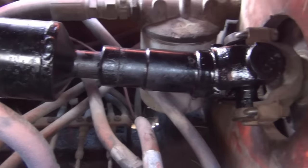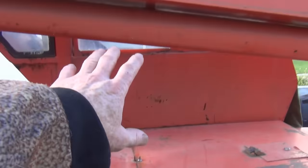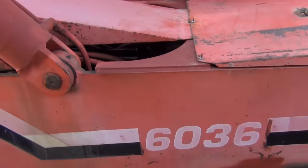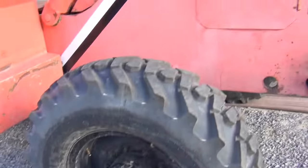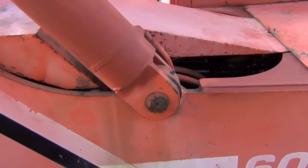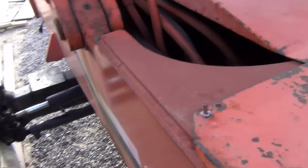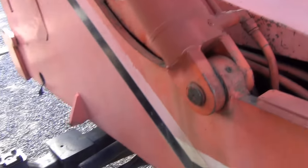That's a good repair. I spray painted it using some ceramic engine paint, I've got both U-joints done with grease zerks on both of them, and I'm going to throw it back in. There it is, all installed and ready to rock. That thing was making so much noise and growling - you sit in the cab and it sounds like everything on that side is loud because that joint was bad. This is a forklift - I've been through flat tires, a shot engine, a bad fuel injection pump, and I rebuilt the engine. This was the last thing really bugging me for being able to move it around and store it off-site.